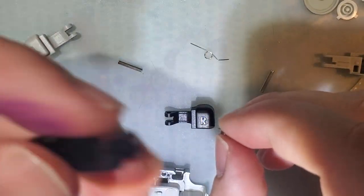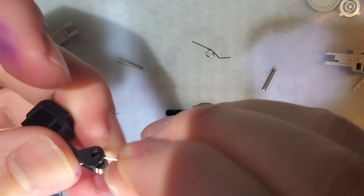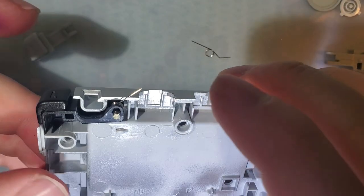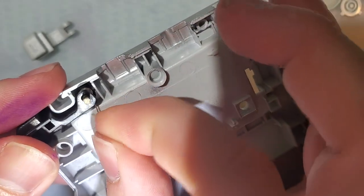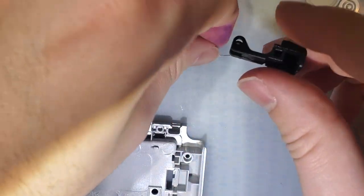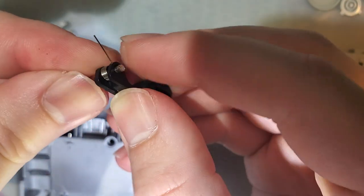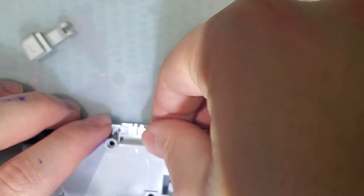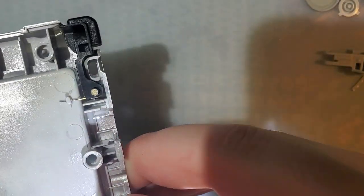As far as reassembly goes, go ahead and flip this over, put the curved portion inside that slot, and hold it with your thumb while you put the coil in the middle, and you can slip that pin in, and then slip it in the shell, just like that, and you can bring the hinge around, or the spring around, and drop it in the catch. Again, sorry if I make this look tremendously easy, but I've got years of practice. Okay. Boom.